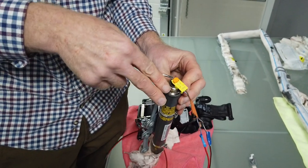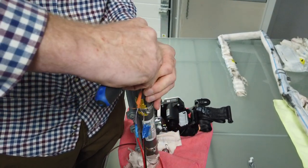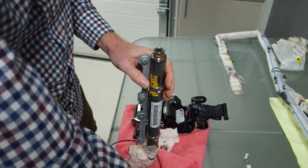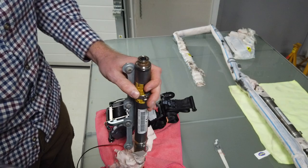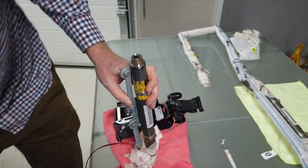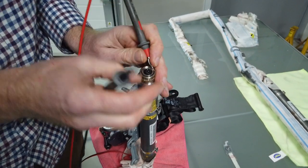When you remove these connectors you've got to pull this central bit out first and then lift off the connector. Don't go trying to probe live airbags because the voltage from your voltmeter will in theory set them off.